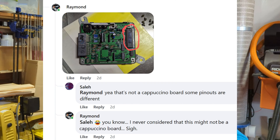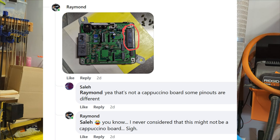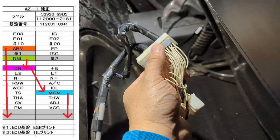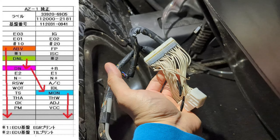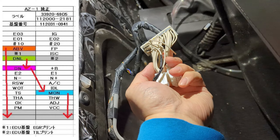After contacting some electrical engineer friends for advice on fixing this — whether it's a dead chip or something else — they told me it's easy to fix if I can figure out what it is, but I'd need a circuit diagram. I checked the internet and posted in a Facebook group for Kei cars. They mentioned this isn't even a cappuccino ECU just by looking at the board. I had made a harness adapter because I had a cappuccino N1 ECU and made a little harness that switches the pins however I needed for it to work — but it never crossed my mind this was not a cappuccino ECU, because I was told it was.